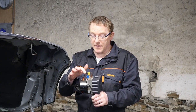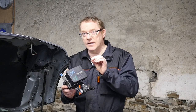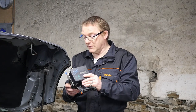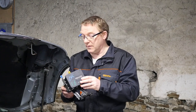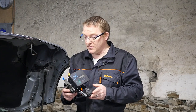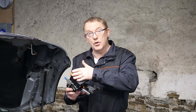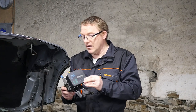Apparently inside there is a pressure sensor with tiny little wires finer than a human hair — not ideal in a hostile environment like a car. They can break, and then the module gives a 5DF code and several other codes. There's also talk of a connector strip inside that is pushed on, and over time the connections break and can cause the same issues. I'm going to see if I can solder those connections.